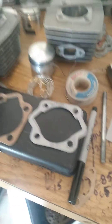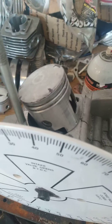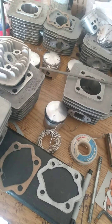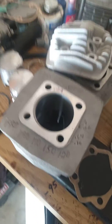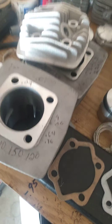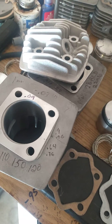Consider how much the gasket is going to compress and you won't be struggling. Choose the heads your buddies use. He's going to have to come up with pistons because all of the ones that came with it are the wrong pistons — thankfully I still have an old piston here. So I've got to deck all cylinders one millimeter, and that way I come up to a 0.9mm squish after the gasket compresses — probably 0.85 to 0.8, super safe.